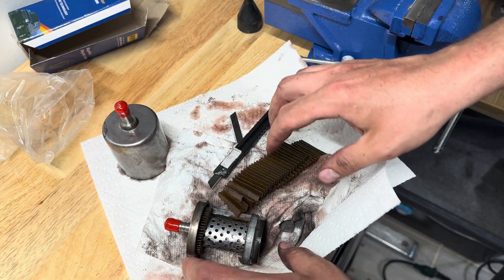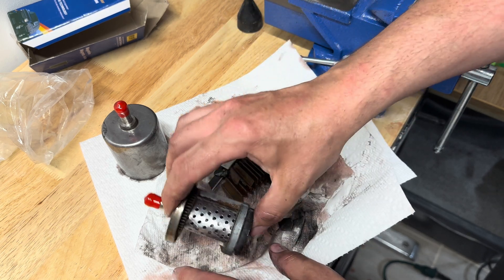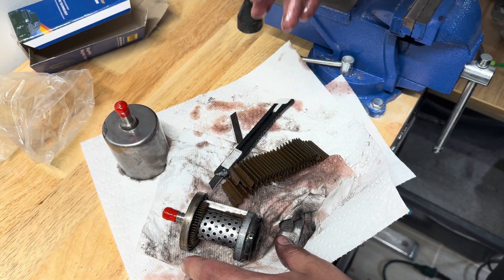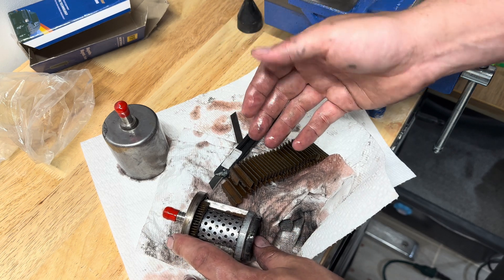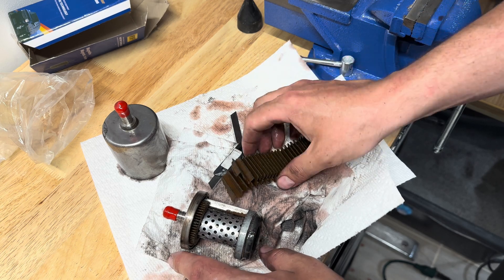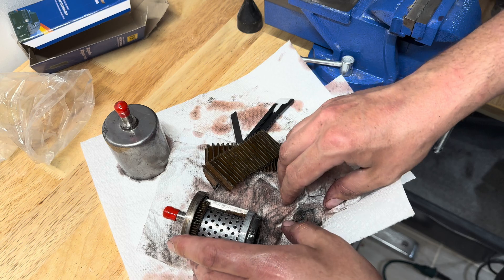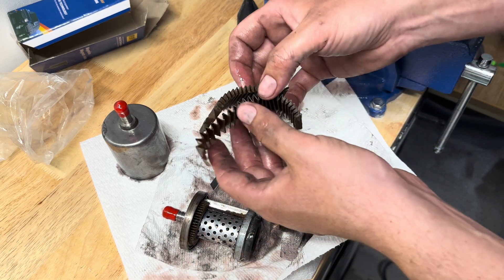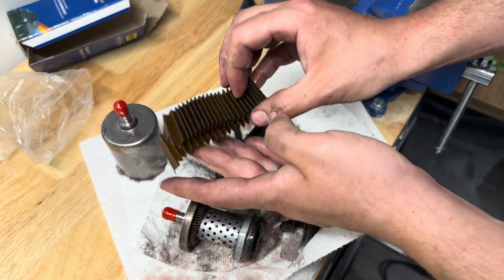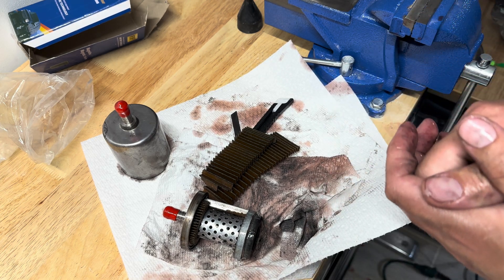I'd say it depends on the condition of your fluid. I did put this on the vehicle just after I did a quick dump of about four quarts. I didn't do a flush, just a regular dump and fill — so keep that in mind. Maybe 40 or even 50,000 kilometers might be good to swap one of these out. That's all there is to it. Hopefully you found it helpful. Please don't forget to like and subscribe.